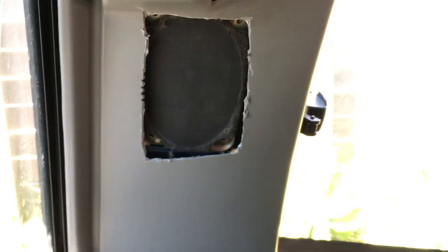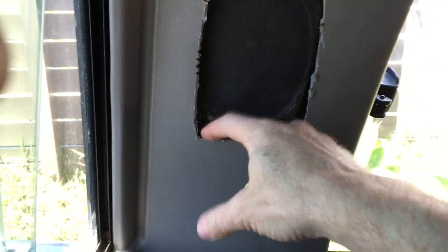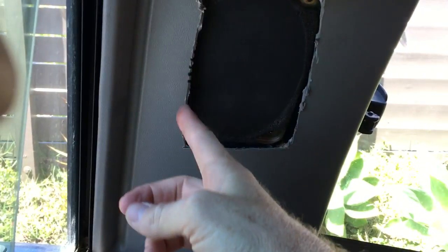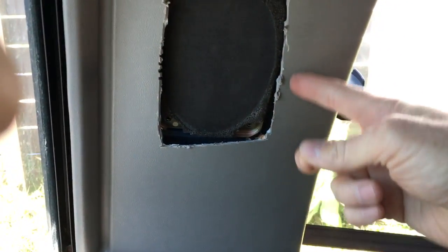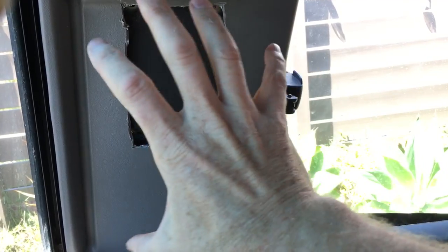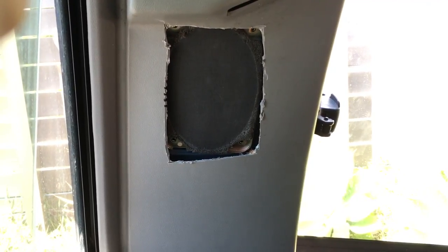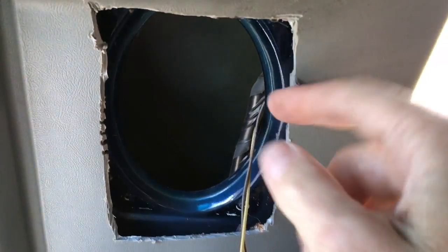I have seen evidence of people putting a 6x9 speaker in here. So if you want to go big, you can do it, but you'd have to cut away some of the sheet metal because there's sheet metal right here. So if you wanted to take a metal snipper and cut a big hole in your sheet metal, you could put a 6x9 in here. There is enough room behind it if you space it out right and then use the grill on there and just have a massive woofy-tweety three-way speaker there.